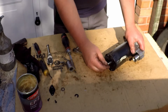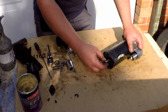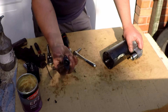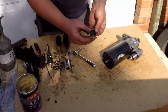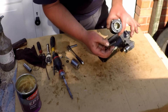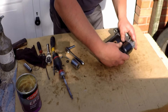This is where the shaft comes out and you'll see there's a bit of movement there, a bit of play. Just a little smidgen of grease on there to help it move. This little C-clip doesn't actually really secure that much - it just sits there to stop that from spinning out and disappearing. That's where that goes in - there's no actual bushing in there. Just put a little bit of grease around there, put that in and it'll just merge together. A little bit of resistance, which is good.